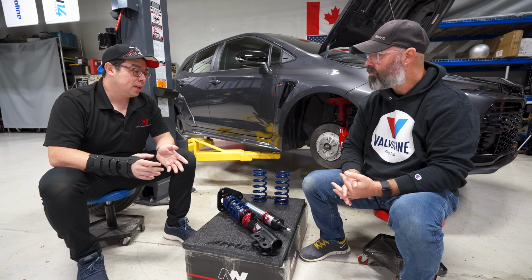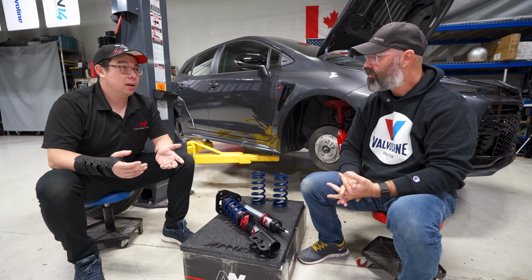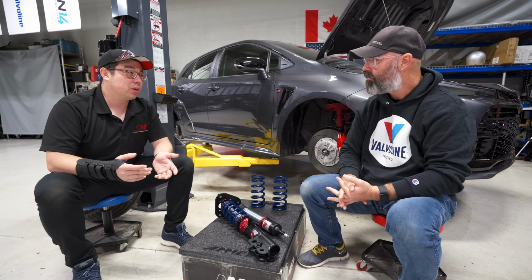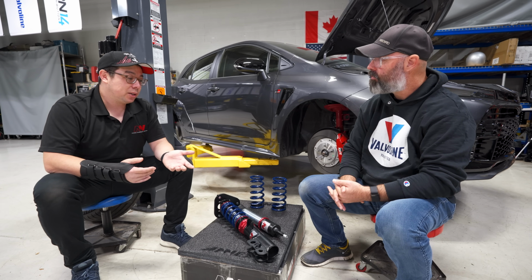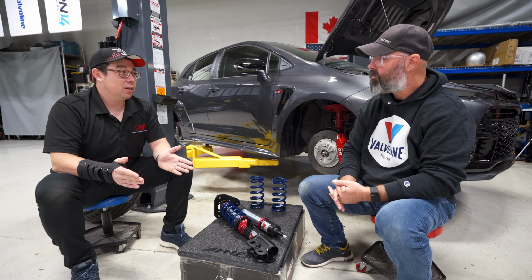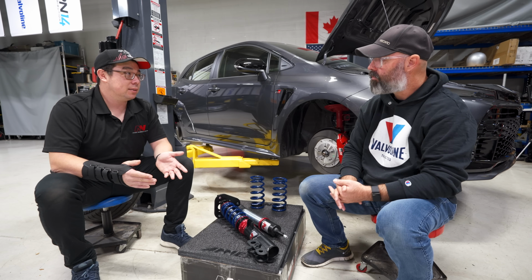it's quite difficult. So for example, if we take an out of the box inexpensive coilover system, or sometimes even mass produced but well-known shock companies, will dyno their shocks, there could be as much as 20 or 30% variation. That much? On the dyno, and then I've also been privy to spec sheets from manufacturers that will say, oh, we're okay with this much variation because it's very, very difficult to make shocks that match at scale, right?